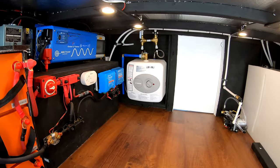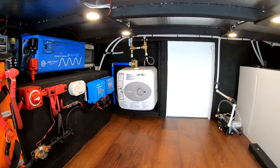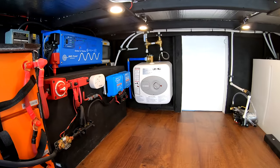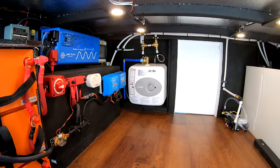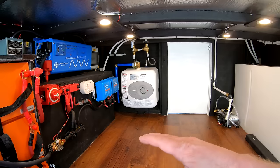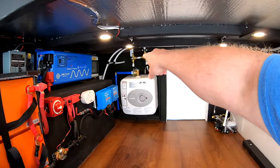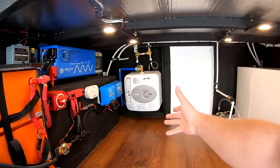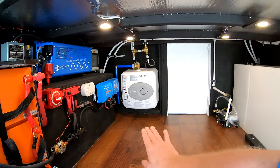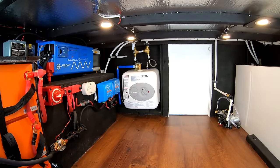As far as the water heater goes, we did go with a Bosch 4-gallon 120 volt water heater just to keep everything all electric. The only difficult thing about going with this very popular water heater in a van conversion is if you need to drain it, which you need to do in between uses if you use the van on a non-daily basis, just every now and then to go camping. I put quick connects on the fittings up there, that way I can pop them off and the whole thing just pulls up off the wall and you can actually turn it over and drain it out here. It would be nice if there was a unit electric like this that had a drain that you could just open in the bottom and drain through the bottom of the van.